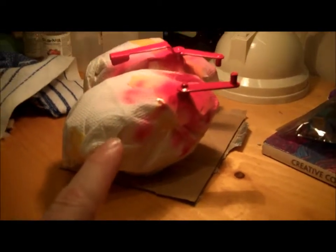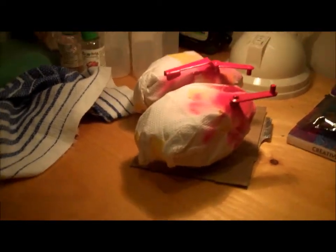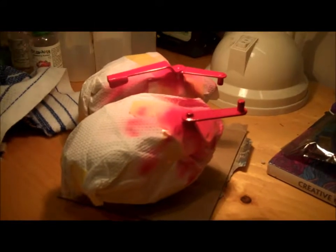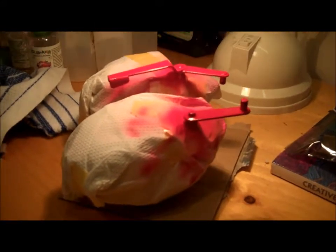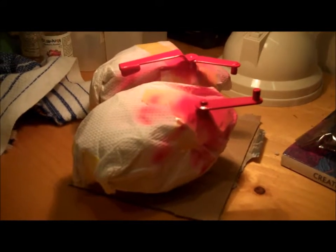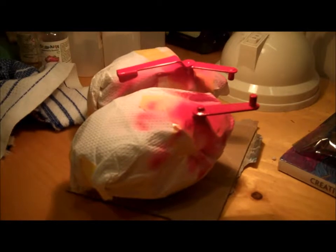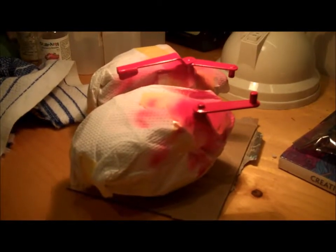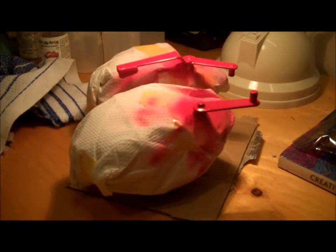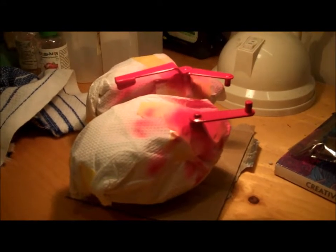The next step on the carbs is to put the seals in, replace all the seals. They've arrived. Just waiting for the hoses, the fuel hoses and the drain hoses. They're arriving hopefully next week, and the carbs should be done and finished, and we can get them back on the bike. I've also cleaned out the cables as well, the throttle cables, so we'll lay the cables in and refit the carbs, and I'll show you doing that in a future video.